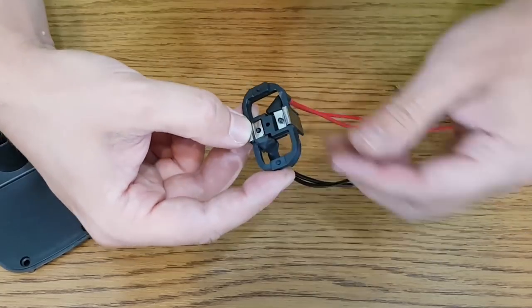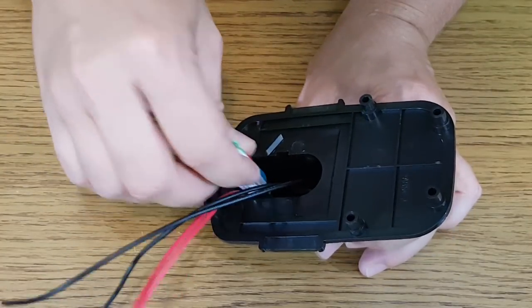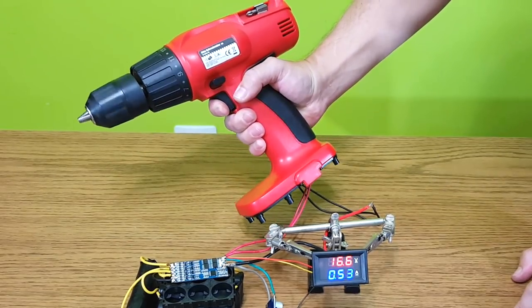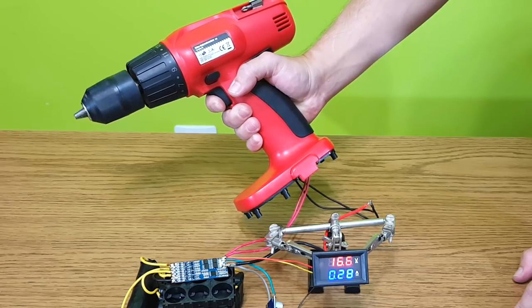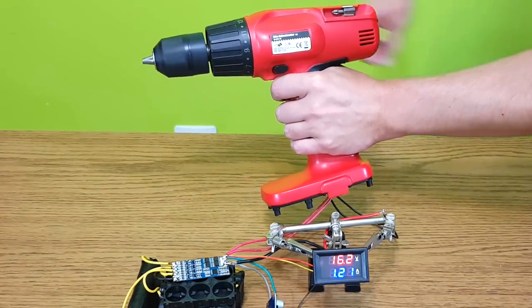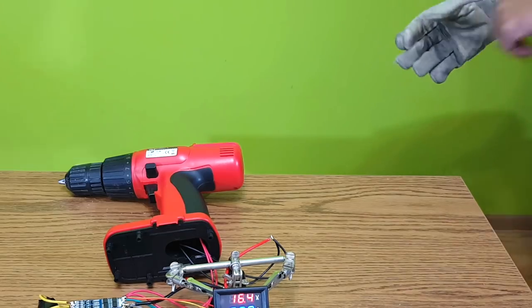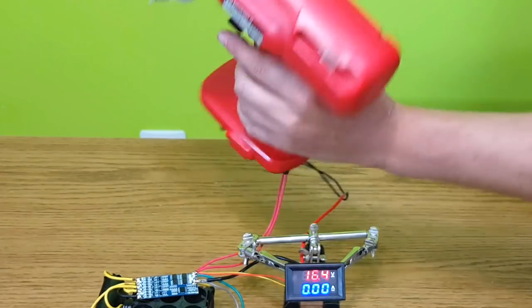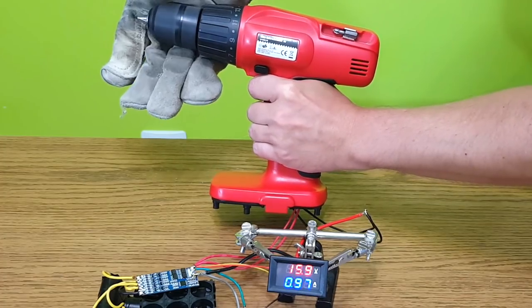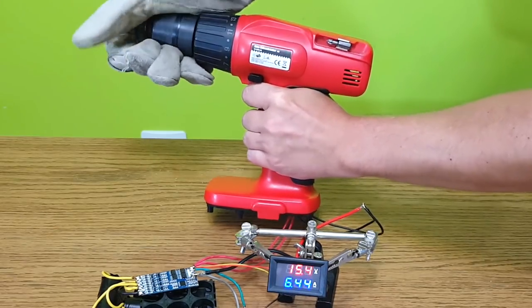I'll still use the battery terminals but solder 2 wires to each pin so it can deliver power without any loss. I need some super glue to fix it in position. Let's test the battery pack using the voltmeter and ammeter. The cordless drill has only 2 speeds: the first speed uses less than 300 mA, the second needs a little over 1 amp. Adding a load to the drill and testing in real conditions — now it has enough power to hurt my hand! Setting it to the maximum torque limiter, you can see it actually limits the maximum current consumption to less than 10 amps. I'll consider the torque limiter a good safety feature.